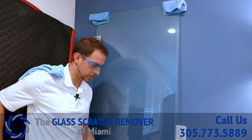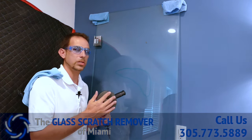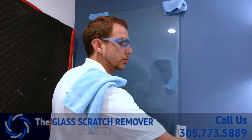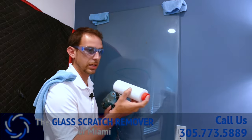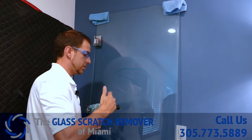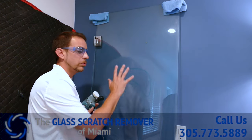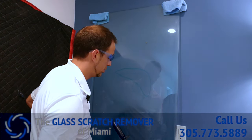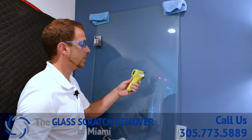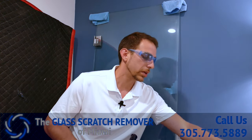Now that's pretty clear. As you can see, this has been a dry process — we're not introducing any water, no sprays, no Cerium Oxide yet, which is a liquid paste. Since we've just finished this last pad, now we've got to go to the Cerium Oxide. We need to let this cool down just a bit because the temperature is always being driven up. We're at about 120 degrees overall, some spots 110 or so. We're just going to let it cool down a bit.